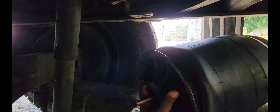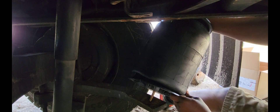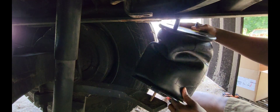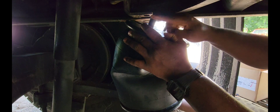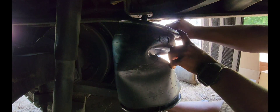So putting the airbag on can be easy. First, we're going to take this little dust protection cover and take it out — you squeeze it together like this. All you have to do is put the bottom piece right in there. Be careful with the thread, squeeze it a little bit together. So we have the bottom piece in. Now what we're going to do here is the air nozzle connector — we're going to put that in second. You guys can see that coming out right there. And then the last piece goes into that plate right there. Now it's back on.